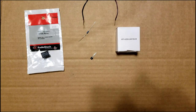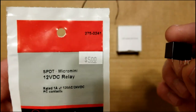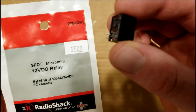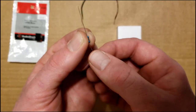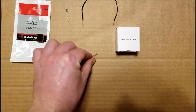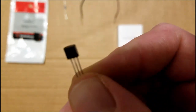The supplies you're going to need are one single pole double throw relay, 12 volt. There's the part number there, and it looks like this. It's got 5 pins on it. You're also going to need a 1/4 watt, 10,000 ohm resistor, and a 2N2222 transistor,